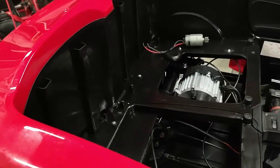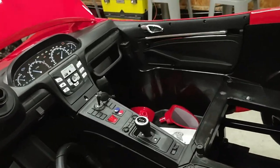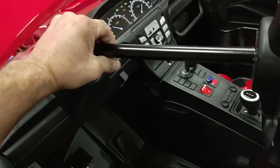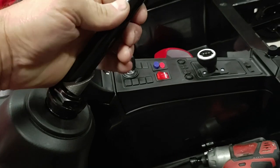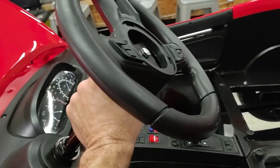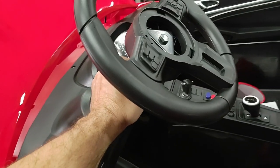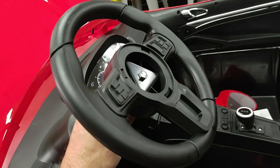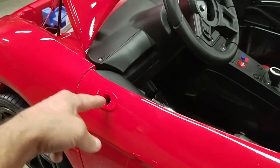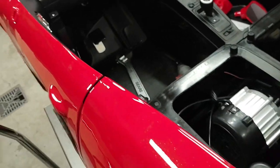The steering wheel comes with its own wrench, but it takes a 12-millimeter wrench. You slide the wedge in there and it gives a telescoping effect for easy adjustment — great for an adult. Keep your wheels perfectly straight, align the triangle, and tighten it down. The mirrors just pop right in — compression fit. The seats take two screws in the back, and the windshield pops down in there easily too.